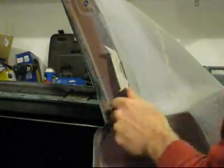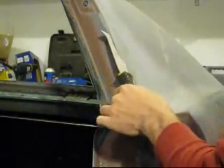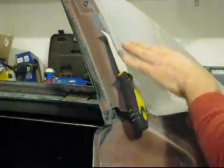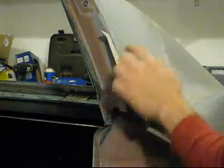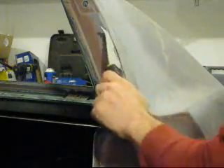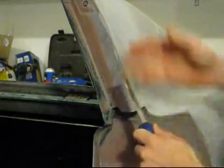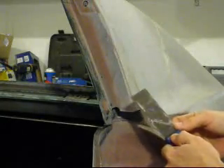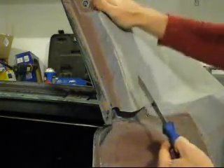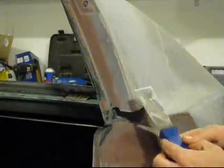This is about how far I've gone, and you can see that if I try to go much higher than what I've already heated, it's starting to get much tougher to separate and the panel is actually bending down. You can tell that if I kept going, this fiberglass panel would splinter and break apart. So I'm going to stop here and continue heating. I'm likely going to switch to this more flexible putty knife — it can bend quite easily and more easily follow the curves of the panel, helping reduce the likelihood of damaging it.